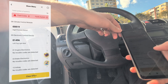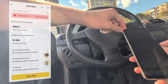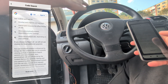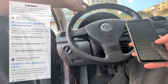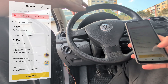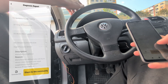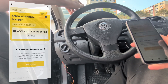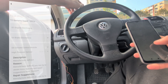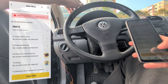You have a few options: you can clear fault codes, or you can use the built-in AI that will tell you more about each fault code. For example, I selected a code and got it explained along with steps to solve it. If that is not enough, you can click to search the same code on the same car directly on Google. Even if you don't understand fault codes, you have a bunch of options to help. There is also an option to clear all DTCs — 'clear fault code memory completed' — however one code could not be cleared because not every code can be cleared with just a scan tool. The diagnostic report in this scanner is, I think, the worst-looking diagnostic report I have ever seen, but it is a small detail and most people probably won't need reports.